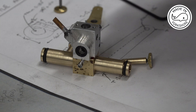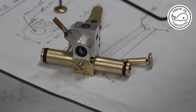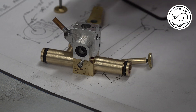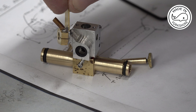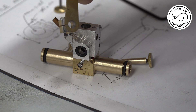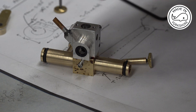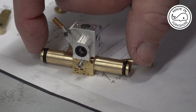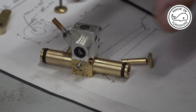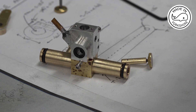I stripped the carb down to solder this piece of copper tube into the aluminium body and found out that you can't really solder aluminium — I wish I'd known that before, because I'd have used an aluminium rod to hold those two parts together instead of that stainless steel screwdriver. But you live and learn. What I ended up using was a bit of JB Weld, which I left overnight. While I was waiting for that to go off I made this little manifold to fit the carb, so it'll fit hopefully nicely on the Hoglet — it's just a matter of putting it all back together again.